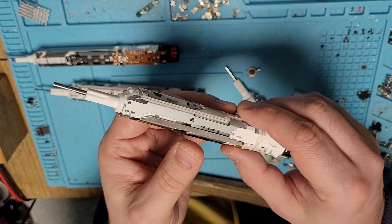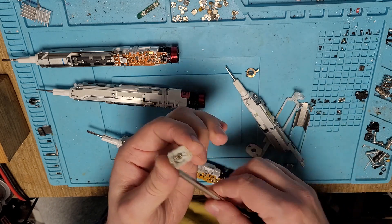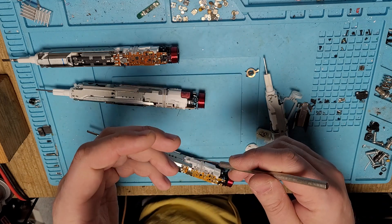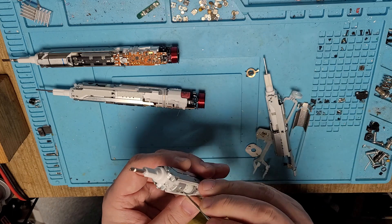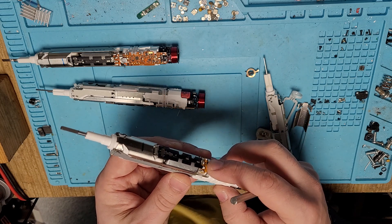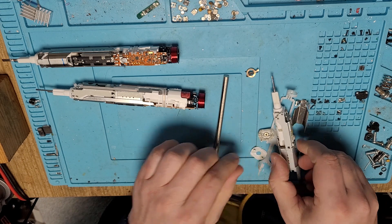What I'd suggest after freeing the motor is to leave it running for a minute or two. If it had any welded places on the collector, running it will smooth them down. I had one case where I hammered it, turned it on and off, and then it stopped again - I had to hammer it one more time, though not as hard as the first time. So leave it running through a cycle and in principle you've repaired the brush.